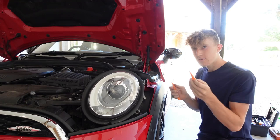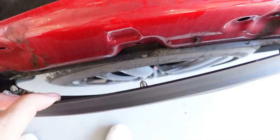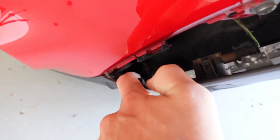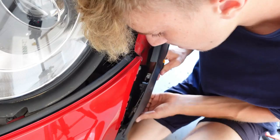Coming around the side, focus on the wheel arch - the little plastic bit. Get some pry tools behind it and start levering it out. We've removed these five clips around there, and now we need to unplug the parking sensor and get a flathead screwdriver down there because there are two more clips to take out. After that being a bit of a pain, it is now out.